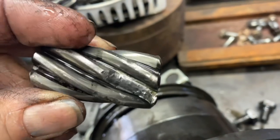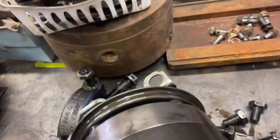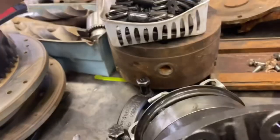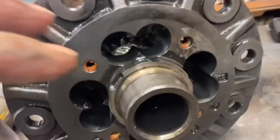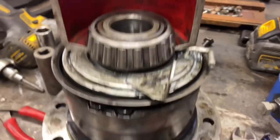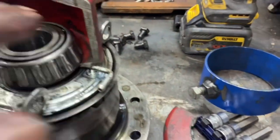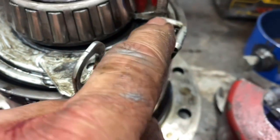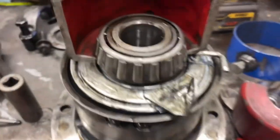Obviously you can see that's not the way it's supposed to be. This has something to do with the air locker — one set of these moves up and I think it binds on the other set. There are eight of them in there, some long and some short, and they've all got teeth missing. Next I want to see the rest of the inside of this thing. I'm going to cut this air fitting off so the bearing puller can work — normally one piece goes on each half of the bearing, you put a race on there, and the other piece pushes down and pulls up. But this air fitting is in the way, so I'll just cut it off. This is going to the locker shop; I just want to take it apart and show you all what's inside it.